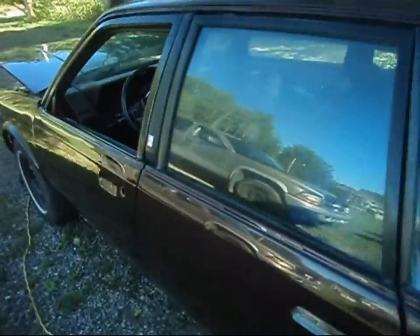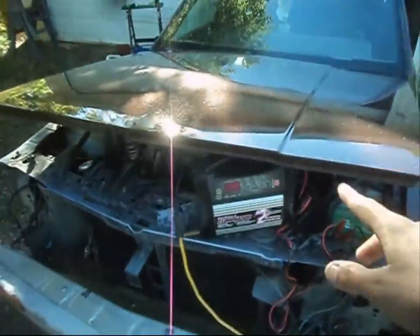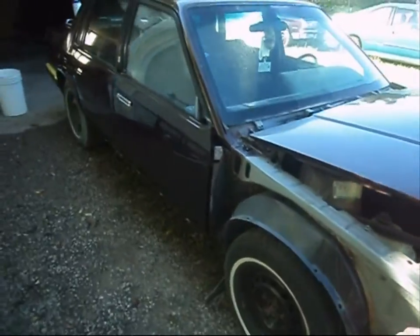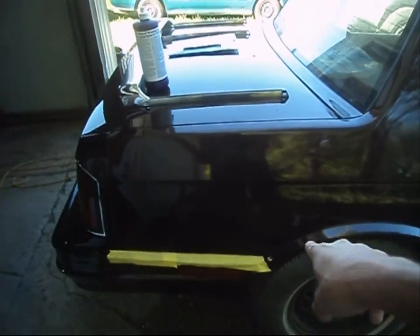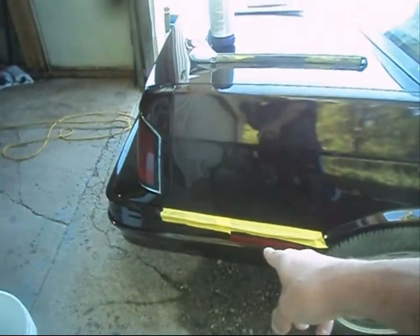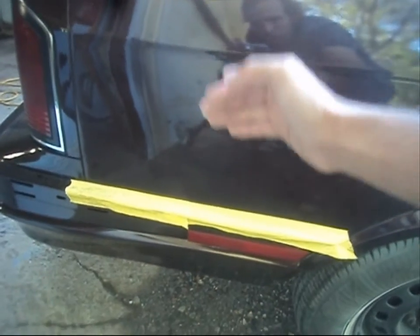What I'm going to do here is — seeing as I already started here, I don't want to do this quarter panel right now, and I can't do the hood because I have this battery charger sitting here. The alternator quit out of this vehicle and the battery was dead this morning. So I'm going to start with a big wide open spot — this quarter panel right here. You're probably wondering why there's this tape here. When you start wet sanding your car, you're going to have this white milky clear coat running down and it's going to turn your driveway a milky white. That stuff should not be left on paint. The tape is here to prevent my clear coat, once I start wet sanding, from running in behind the bumper and laying on the paint beneath the bumper.